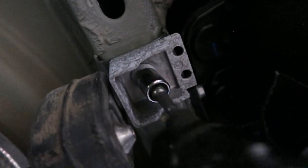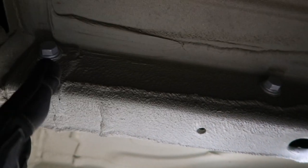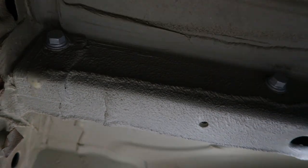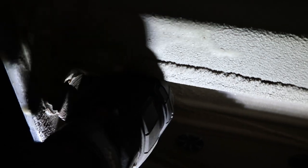Now the passenger side hanger. Once you've got the exhaust hanger bolts removed on both sides — passenger and driver side — you have two 16 millimeter bolts; go ahead and remove those. That's what we'll be attaching the hitch to. Now just get the bolts out of the driver side as well. It's a lot easier if you jack up the vehicle and put it on jack stands, but if you fit under the car like me, this kind of works too.